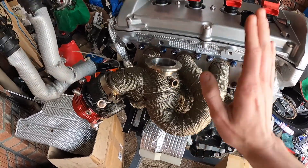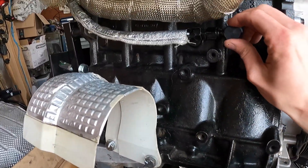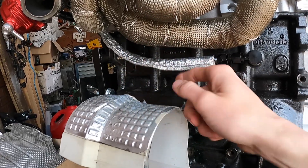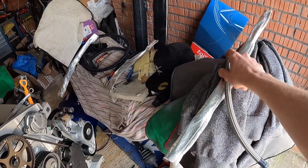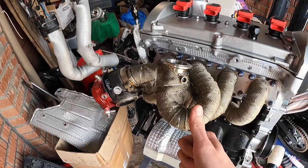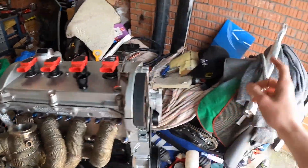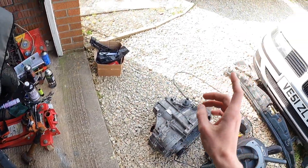So this is all done. Hopefully this is going to stop heat getting everywhere - too much heat soak into the bay. Obviously I've got my coolant feed which is down here, this has got a heat sleeve on it anyway, but to keep some heat off of it. And the same with my drain - it's going to have a heat sleeve on it anyway. It's better to have less heat coming off of it, just so everything stays as cool as possible. Big thanks to Funk Motorsport for the wrap. I'm going to get on and show you how to do this drain before the battery dies, because I need to get on and get this off the stand. I'm probably going to chuck it in the spare tire, flywheel and clutch all on, and ideally get that box on because I want to put it in the bay tomorrow.